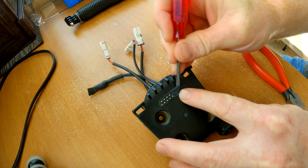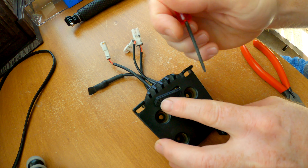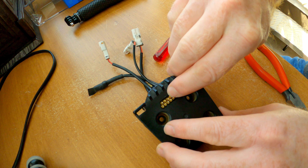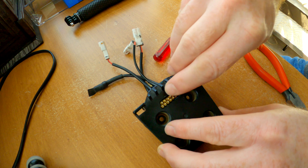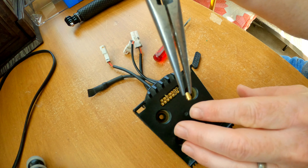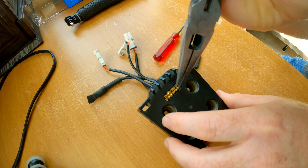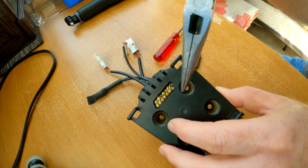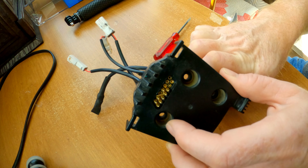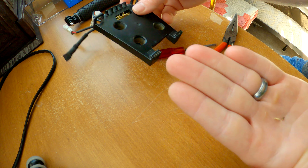What you're going to do is pry off this rubber seal. You just carefully take that off. It's going to be a little harder the first time because you'll have all those pins sticking through. A tip is to use a pick to pick that out. This was the one that tends to go — the fourth one in on the bottom. Let's assume I just want to show you: you can see this one happened to fall out, that's how easy they come out. To put them back in, they just recess into those positions.